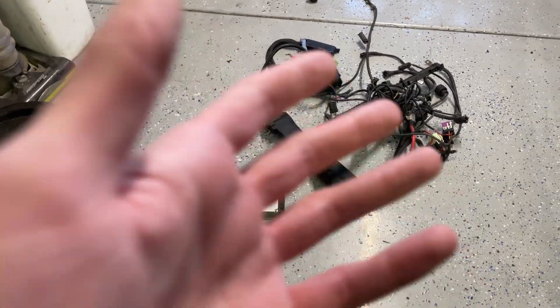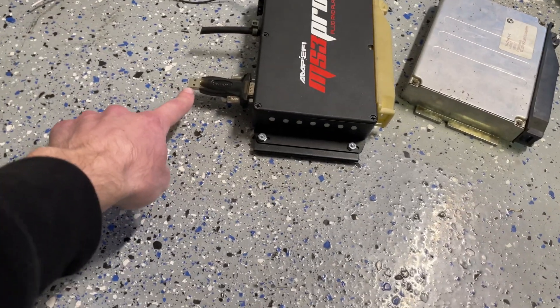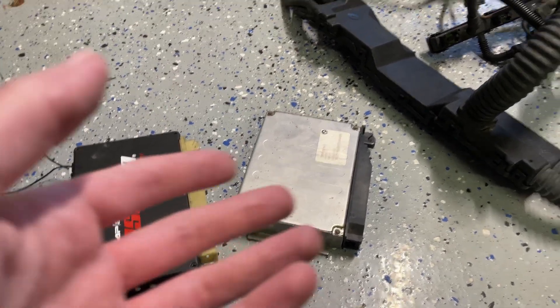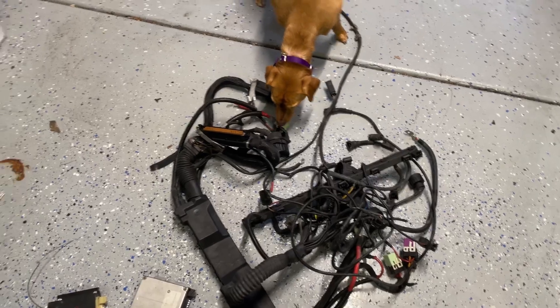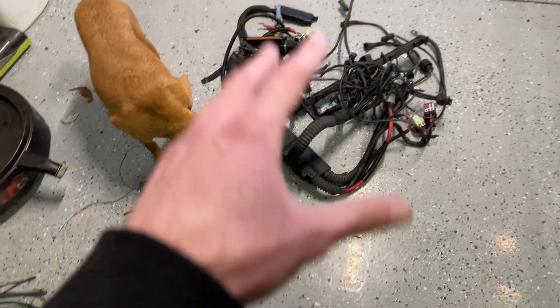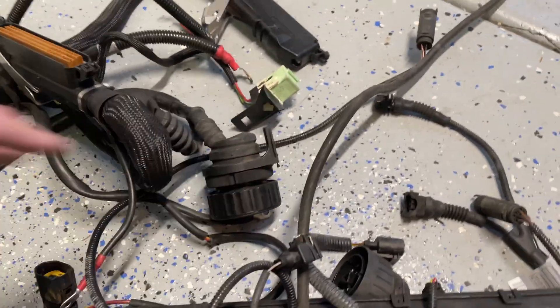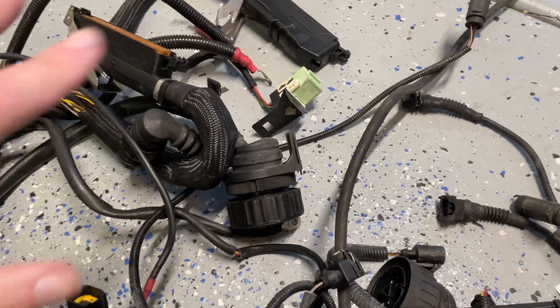Neither one of these ECUs is communicating. I've tried plugging in through USB the normal way with every other stock E36 DME, and neither one wants to communicate - so I think it's his wiring harness. I have this automatic wiring harness that someone gave me that no one wants, so I'm going to hack this up into a bench test setup where I can test the ECUs outside of the car and eliminate his car harness as a variable. We're even going to include the diagnostic connector so I can still connect to it.